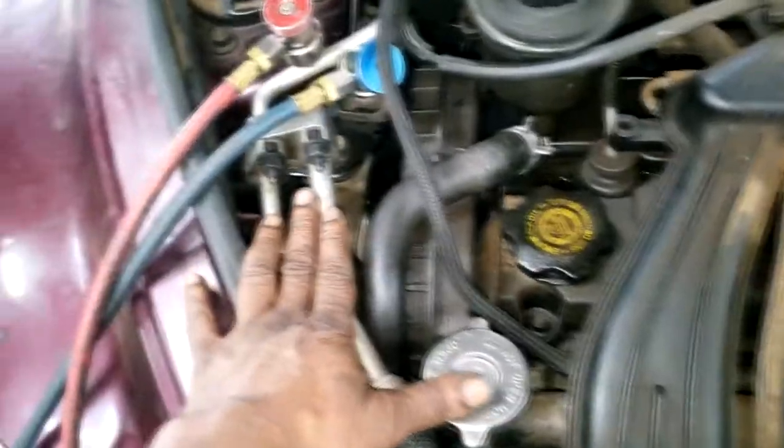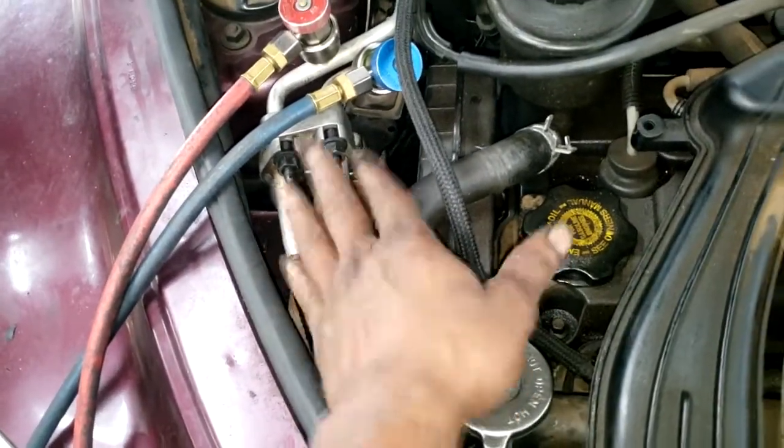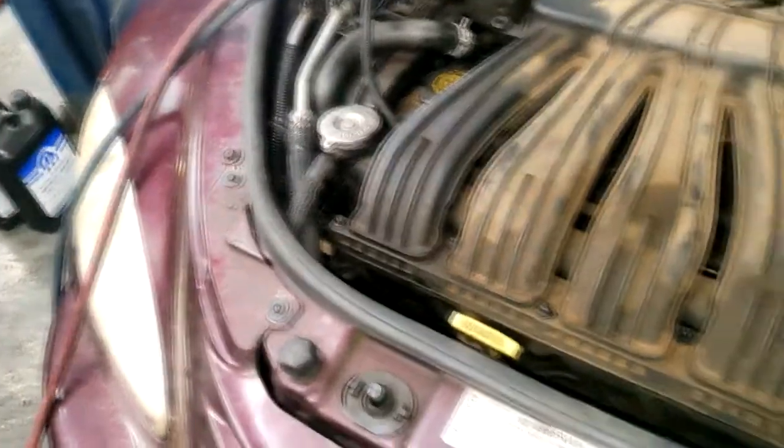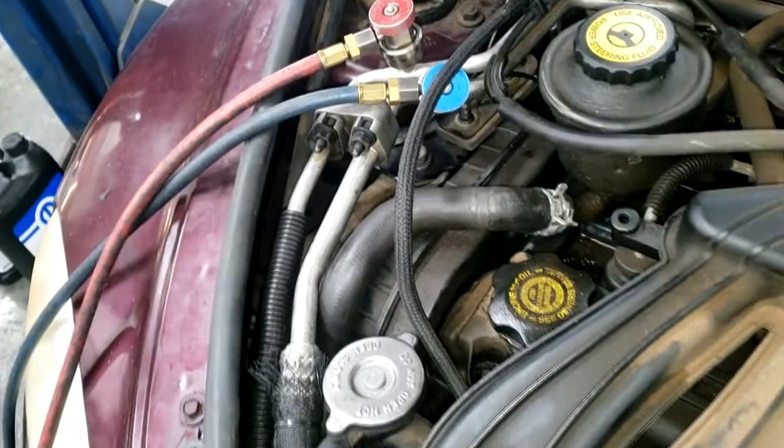Some of you guys are so against taking things off you may not know — here's the old timing belt. I have to take this off when I do a timing belt because I want it out of my way, which means in order to get it off you've got to drain the AC. So I got the AC drained, and now I'm going back together with it. I'm done with the job, everything's back together, it's time to close up the AC line and refill the system with freon.